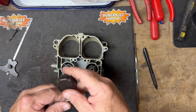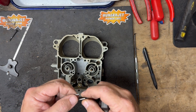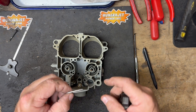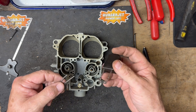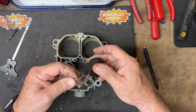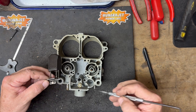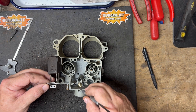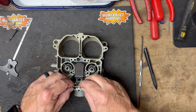Make sure your needle is inside the seat — here's the needle, it's going to sit inside there. Make sure it goes all the way down. This is the float pin itself to hold it — you want to make sure it's spread out nicely, not too compact. When you put the air horn on, it needs to touch and hold the float in place. The float has holes that the pin goes through, and you want to make sure those areas are clean and clear — no debris, no casting material, no dirt.